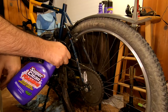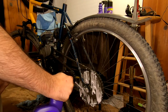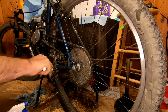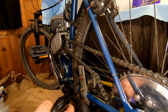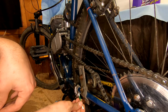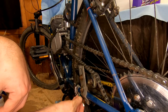In all honesty, the three to one dilution mix can probably clean this entire bike by itself. But to make my life a little easier, I'm going to use the full strength foaming agent on the really nasty areas. With this being the older style spring tensioner, that's not as simple or robust as the newer style that mounts to the clutch cover. On the sprocket side, we're taking extra care to examine it, and the Q-tips get some use here in this tight space.